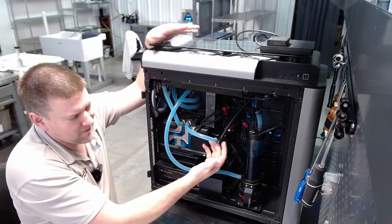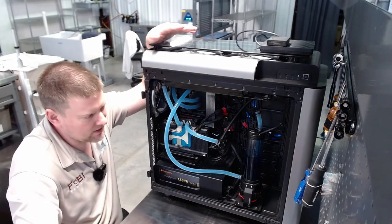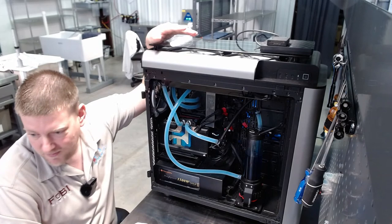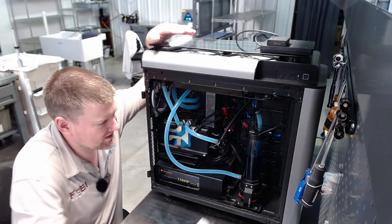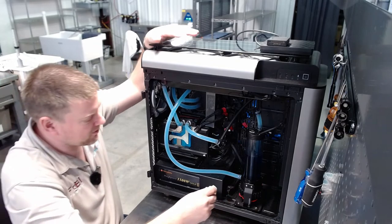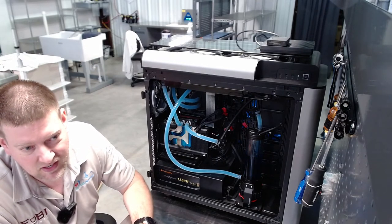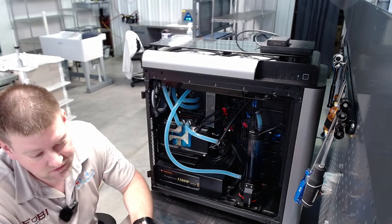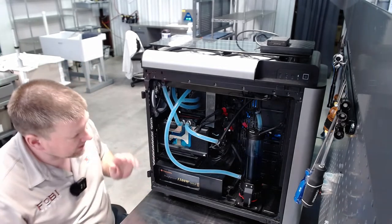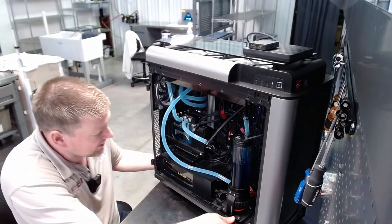You can see right here, I just used the fittings from the OEM because this was an AIO, all-in-one, front radiator. I ended up disconnecting the AIO and I connected it in with the zip tie. Like I said, I'm very utilitarian, guys. I do not care if it looks pretty or not. But what I do care about is that it performs, and this guy definitely performs, all right? There's no shortage of that. My normal temperatures, even under a load, are about 60 to 65 C. That's when I'm really cranking on it, too. So this guy stays nice and cool. So everything is done as well as I think it probably could be, considering the budget that I had and the supplies that I had.